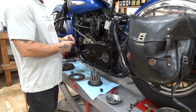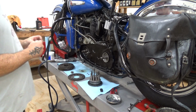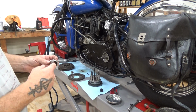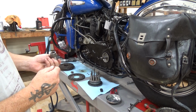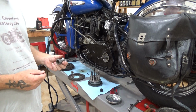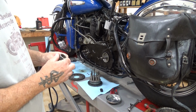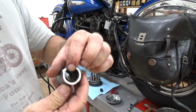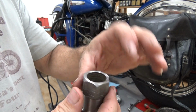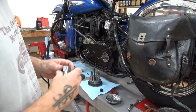And the old Gary Bang ones that I had that were real, I'm getting real low on. Now, whoever serviced this bike left the original cork setup in here with washers and so forth and a snap ring without replacing the cork and putting a seal. That's why the transmission was low, because it all puked out into here, into the clutch. So there's nothing wrong with the original. See, it has a snap ring here. You see that? So I took all that out promptly in the trash can. Don't need it, don't want it. But the nut is good.